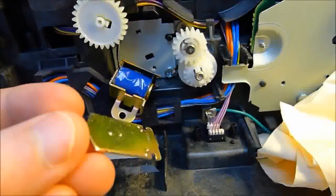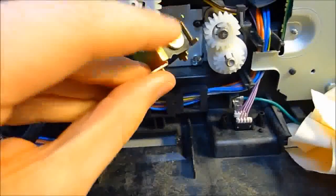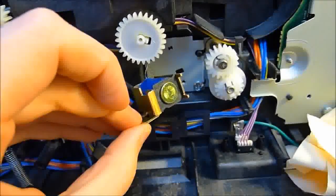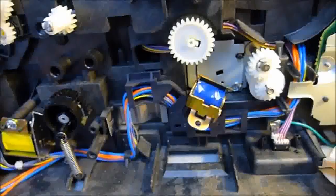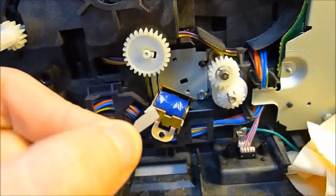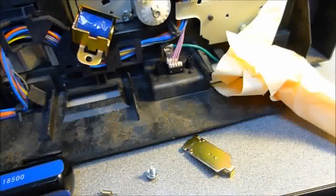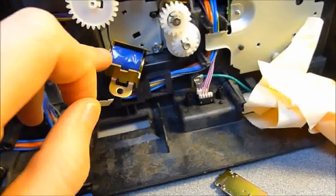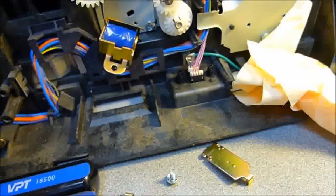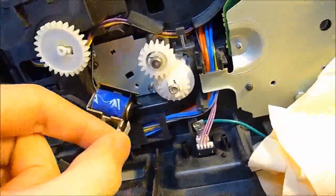As you can see here, we've removed all of the adhesive from the armature of the solenoid and from the body of the solenoid — you can see how clean that is, with more of that black adhesive gone. Now while I was doing this, I looked online and it seems that contrary to what I said previously, we actually do want to take some kind of piece of plastic or some magnetic-resisting material and stick it back where the adhesive used to be. The reason is that many people just clean it off without replacing it, and then there's a problem with residual magnetism from the solenoid — it fires, causes the metal to still be slightly magnetic, and you have the same jamming and timing issues, because all it takes is a microsecond of delay for the printer to jam. So I'm going to stick a little piece of tape back on there.